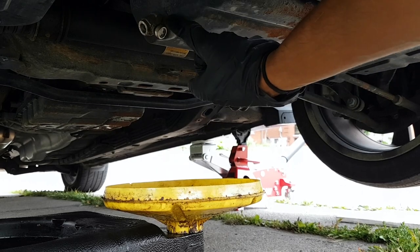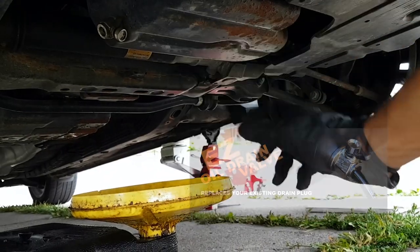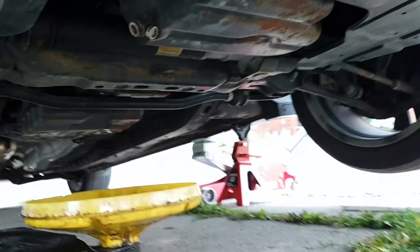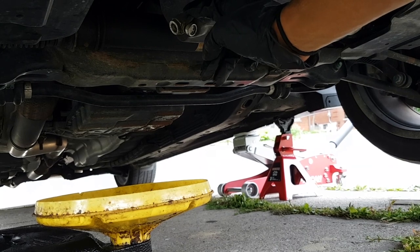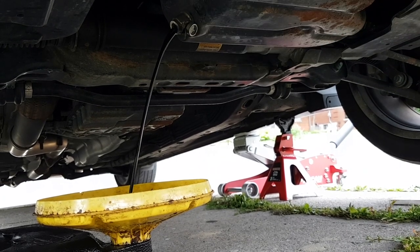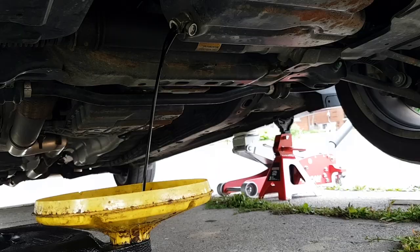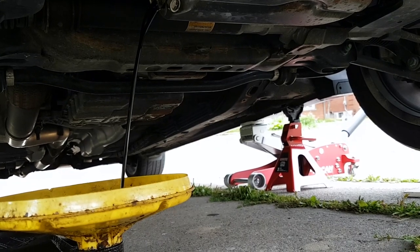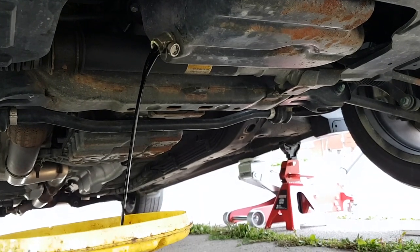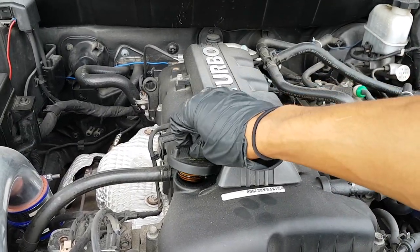Right up here is where there's usually a bolt, but I installed a cool valve instead. You don't need any tools — the way you drain your oil is super simple. There's a little lever; push it down and turn it to the left. Watch the oil just come out with no tools needed. Just let it pour into the pan — there's about four to four and a half liters depending on your car. I usually put in 4.4. Another tip to help drain faster is to open the oil cap.